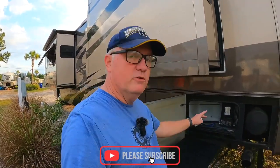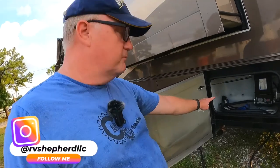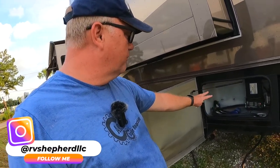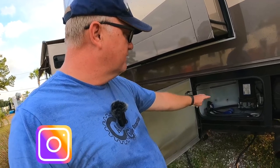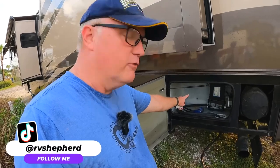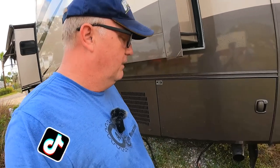I'm gonna close here with some thank yous for watching for now. So we're done with this temporary fix, and you saw what we did. We figured out what the problem was. We saw the smoking gun, and we took out the reel where the problem was. We spliced this cable and routed it straight in, which many RVs are done this way. Lots of RVs don't have reels, and they're just straight in just like this. So that's why this is really no big deal. So we're gonna close this up, call it good, and go inside and enjoy the air conditioner.